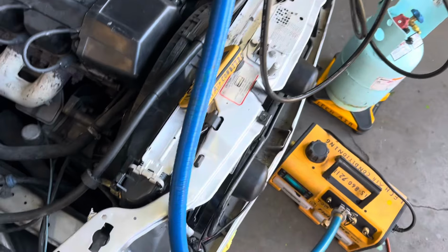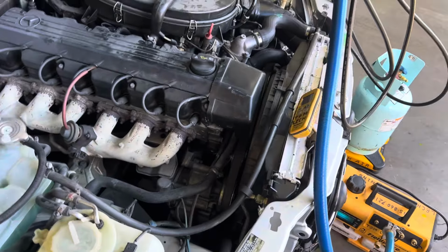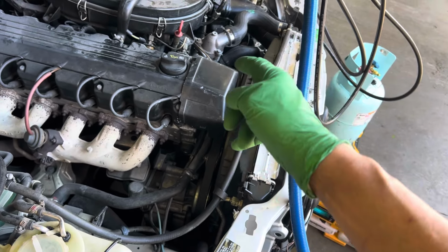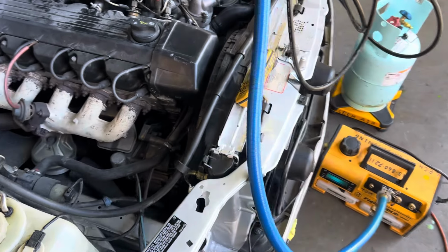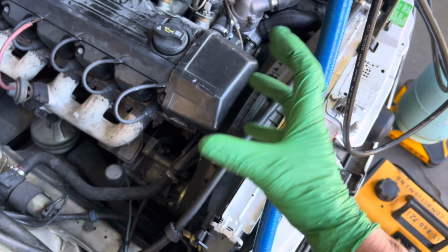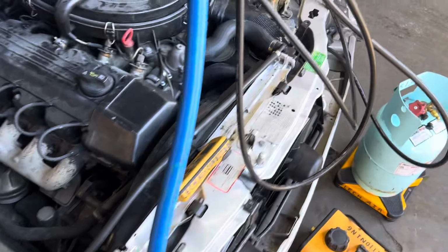But for some reason, the fan seems to be a little bit on the stiff side, where it's almost always staying 1-to-1. And when I did go to move the fan, it was the hardest fluid thermal fan clutch I've ever felt. Like the thickest fluid resistance. Really, really hard. I've never felt the fan like that. I'm wondering if there's an OEM defect, because I see the box that thermal fluid fan clutch came out of, the disc. It was OEM. It was a Mercedes part out of Mercedes box. But when I went to go move it, it wouldn't move. So I don't know what's up with the story with that.